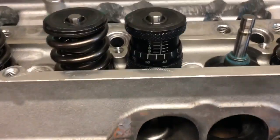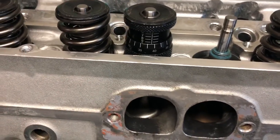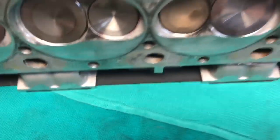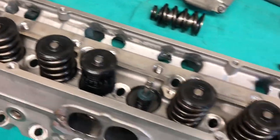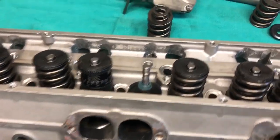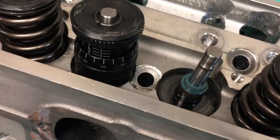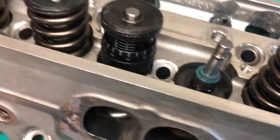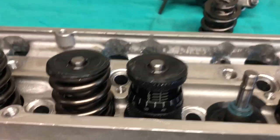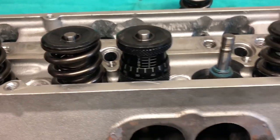Just got this one run up with the mic and you can see this one is reading 1.940, almost 1.938. So when he done the valve job, he told me he had to cut it in there a little bit deeper — that's just part of the valve job he had to do because the seat was so damaged. The only other choice was to either do that or cut the seat out and start over. So what I'll do is I'm going to pull off the seal that protects the head — it's the hardened seat. I've got some shims under it, so we'll measure the shims and see what we've got to do. We need it to be, to match the other one, about 25 thousandths or so taller.